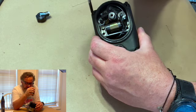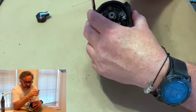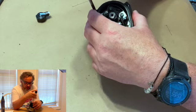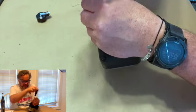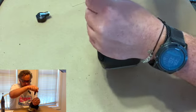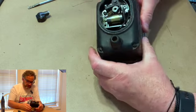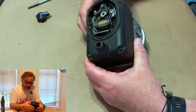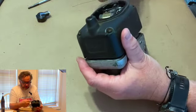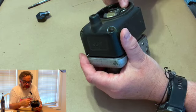So this one is a two-cylinder. If you've got an International Harvester or Allis Chalmers, there'll be four. And all they'll do is add gears to divide the rotation of the armature. The armature is the part that goes around. So when you've got it on the tractor and you've got a piece going around, it's got the magnets on it, and I'll show you that in a minute.